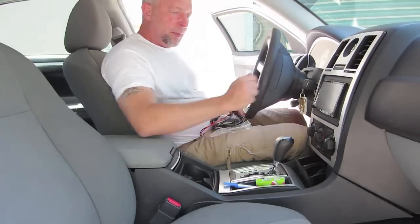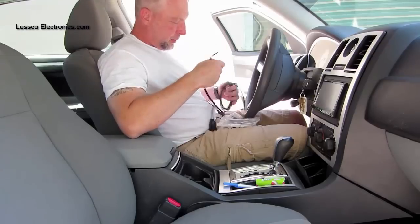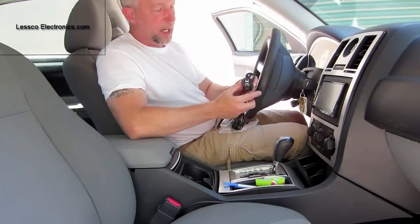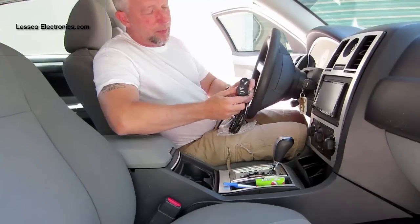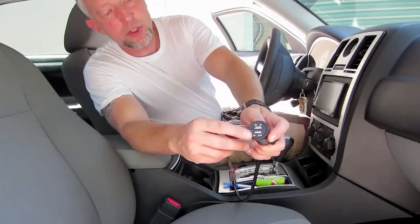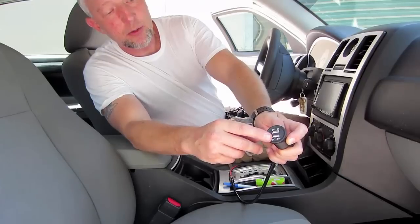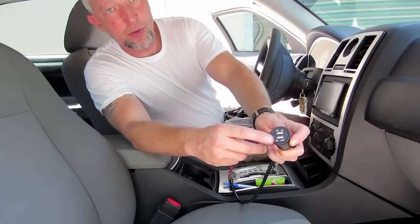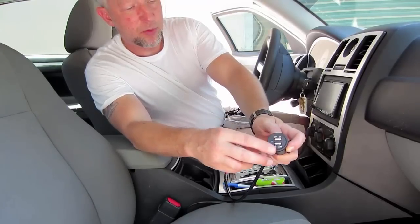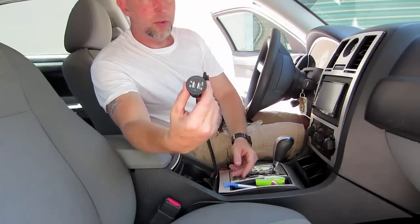Today's video we are going to replace this old outdated cigarette lighter with the new more modern type of plug that we can actually use. Since I have a GPS and a smartphone like everybody else on the planet, I'm going to opt for this dual USB plug. This one has two jacks — on top a 1-amp which you could use for a portable GPS or smartphone charger, and below a 2-amp for something like a tablet with higher power requirements. Most cigarette lighter plugs offer a 10-amp circuit, so this is excellent.